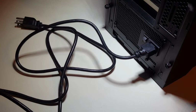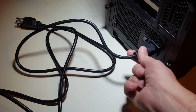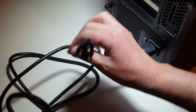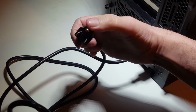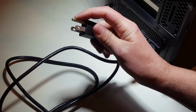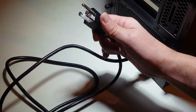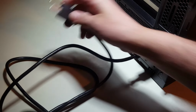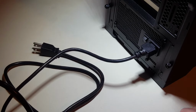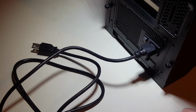Okay, so just to demonstrate the power supply that I'm talking about. Your power supply is in the case. It's plugged in. It's turned off. So now all you have to do is take the end of this, plug it in. This is your grounding cord right here. See that little plug, that round plug? That third prong was put in years ago. Plugged it into another 3-prong connector, which most outlets are going to have today. And that creates a ground. And as long as this is turned off, then you've effectively grounded your case. So that's a quick, easy way to ground your case and protect your components, just in case anybody's looking for another option.